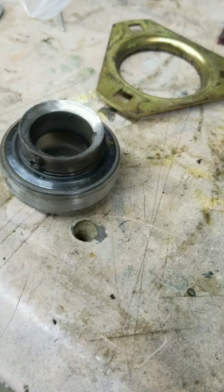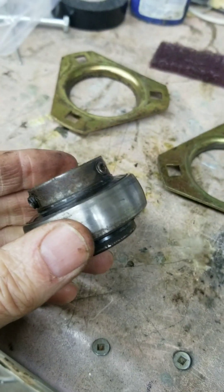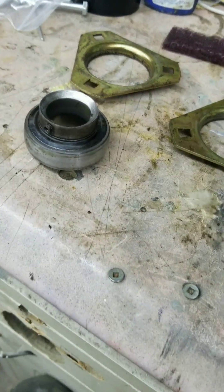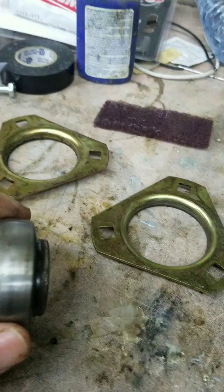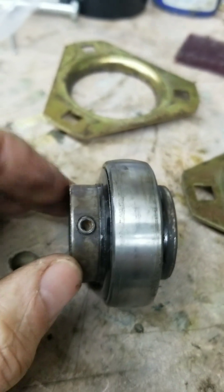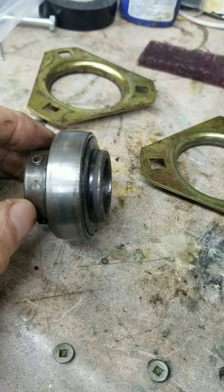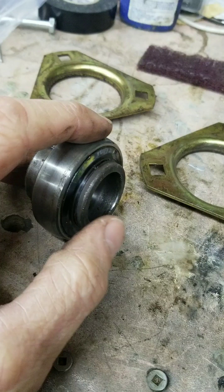Research has led me down a different path because it's discontinued as far as Skidoo's concerned, so I had to come up with a solution as to what I'm putting in there. I've taken measurements of this bearing. The difference between this and anything else I can find — this is the locking collar side with the allen key, allen screws in it to lock it to the shaft — and the back side over here has a collar sticking out.